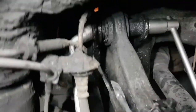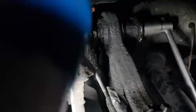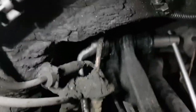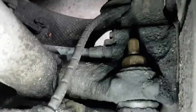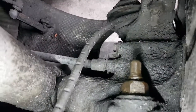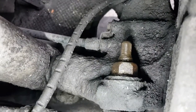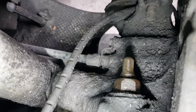Apologies — because I'm on my own I can't really demonstrate how I'm doing these things, I can just show you snapshots. Once I take the nut off on this side, the bolt will slide out from that side to the right, and that should free up this part of the arm. Then I'll move on to this — I've cleaned this down too. That nipple-looking thing sticking out is a 10mm hex, and the big one is a 21mm. So I'm going to use a 21mm spanner and hold the 10mm hex with something similar to what I have on the right here, and crack that loose.